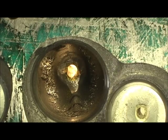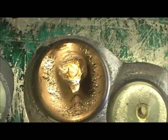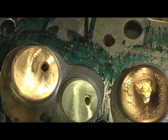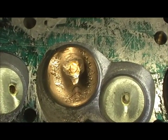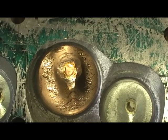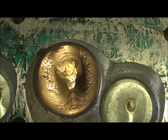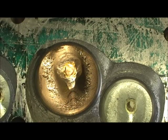Let me put a little light in there so you can see it a little better. Okay, that puts a little bit of light on it, and in comparison to what we've got over here — this is where a lot of the work is on this deal. This guide is the main issue because they've done a great job of raising the port taller, but think of all the airflow that's being blocked off right there.